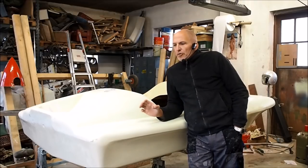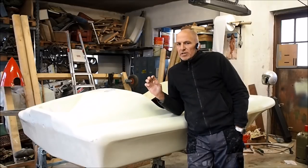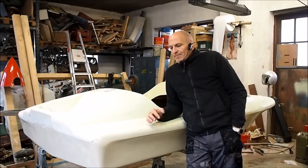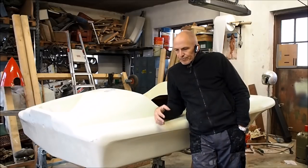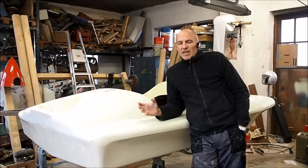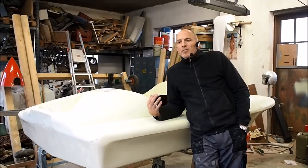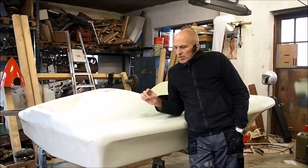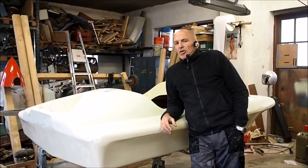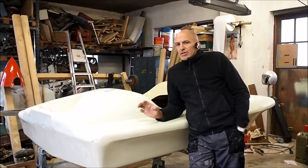She'll get a first coat of base coat in chocolate brown, then I'll do all the detailing, so all the tape goes on. She'll get a coat of gold base on top of that and then we'll start flaking. First, gold flake on the gold - when that tape is removed and the gold is covered, brown flake on the brown stripes, contrasting stripes. Then all the masking comes off and all of this will be buried in three layers of clear.